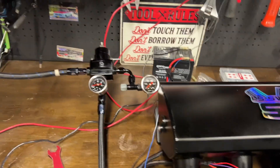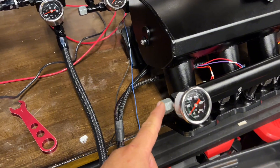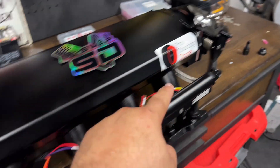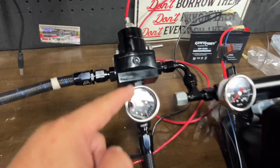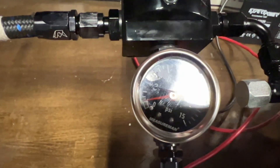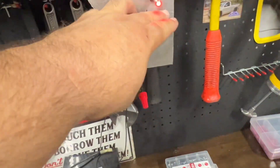So we're back to our fuel system here, and we moved the fuel pressure regulator from the right side to the left side, and we also capped off the right side. So now we should build up pressure to around 60 psi. As you can see, the fuel pump is still hooked up the same way. It goes through the fuel pressure regulator to the left side fuel rail, then to the right side, and then it stops — it gets capped off there. Once we get that increase in fuel pressure, the return valve should open up and relieve pressure to the fuel tank. So let's try it. Our fuel pressure builds up to around 60 psi, the other side is also showing 60 psi, and we have zero psi from our return side. Let's check the injector — the mist is perfectly fine.